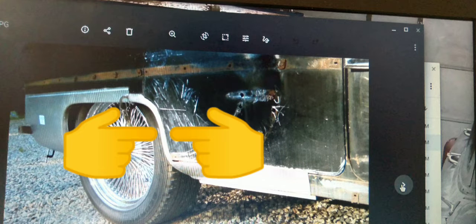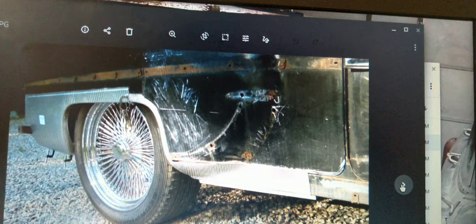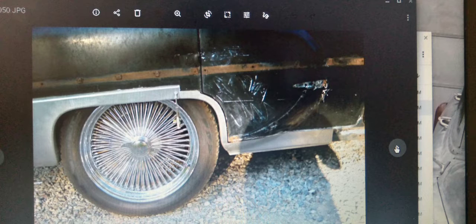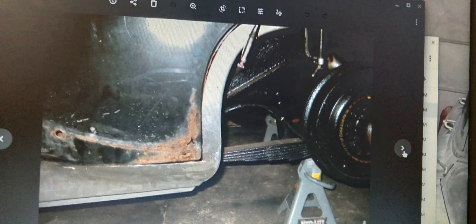Here's the handmade parts I talked about that go around the wheel well edge. You can see here where they go around. They don't make these for a 1953 Chevy four-door. I had to hand make them out of metal, custom for both sides and the in edge where the door itself closes. You can see where it's pointed to in those photos.